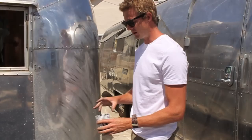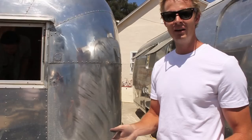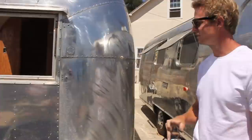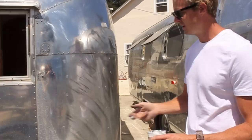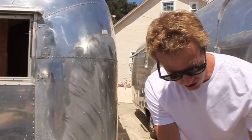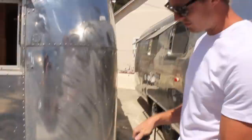To start, take a little F9 on your finger — about that much — and I work in 18-inch by 18-inch squares moving all the way around the trailer. This lets you methodically progress through all three stages of polishing. Apply the polish about six inches apart and don't use too much — using too much polish is one of the biggest mistakes I see, as it makes the process less effective and takes longer.